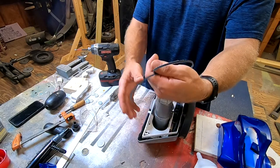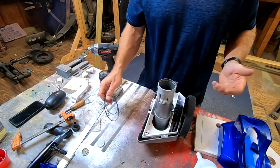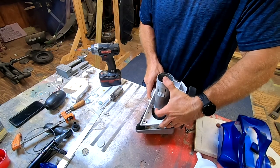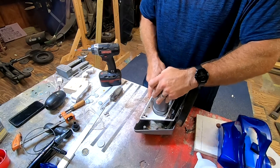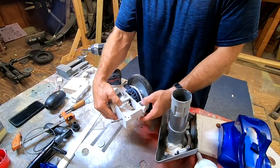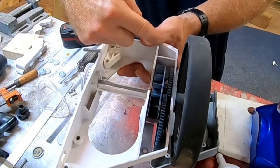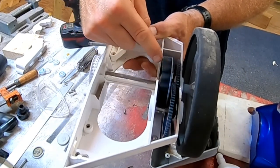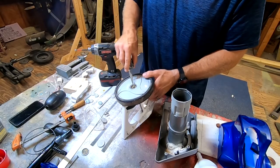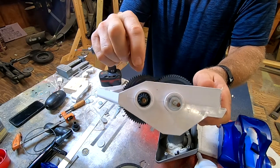Keep in mind you have belts that actually rotate the wheels. They've got ribs on them — one's going to fit and the other one isn't. Now take the entire assembly off. How this thing works: this is what the water actually goes through — it's like a big water wheel that rotates really fast but is geared down so it moves the wheels. Now here's the root of all our issues — see that? It's missing, it's just wobbly in there. That's what we're going to replace first.